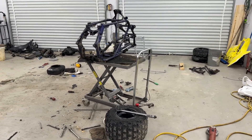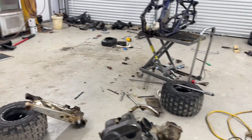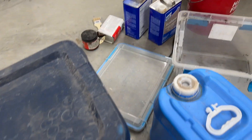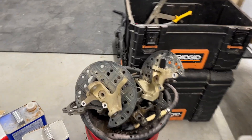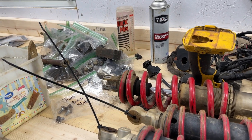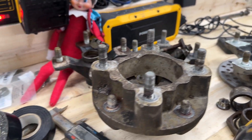Motor should be cleaned up pretty decent and put back on. Over here I got my front bumper soaking in the powder strip — it's the Quick Cut 3 soaking in there. Got to clean all these parts up, got a lot of work ahead of me. I'm going to take the shock supports, get all the overspray off of those, powder coat the springs back red, clean the hardware up, just get it as clean as possible and try not to strip the zinc off. I'm going to put new bearings in the front. Not sure if I'm going to run those rear spacers back on or not, but we've got our work cut out for us.